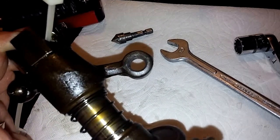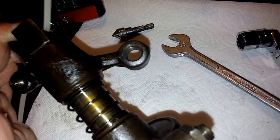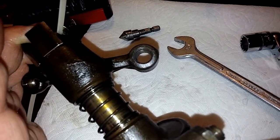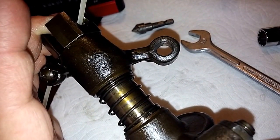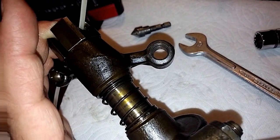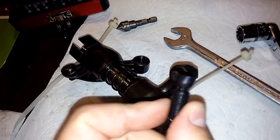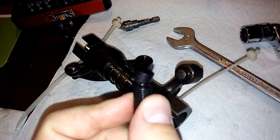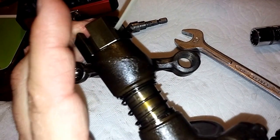It seems like it's only this one valve where the original adjuster barely sticks out of the rocker arm — only 1.5 millimeters. All the other ones are like 3.5 to 4 millimeters, which means I only have to come up with about half a millimeter of clearance for the swivel foot adjuster on those. That's perfectly doable.